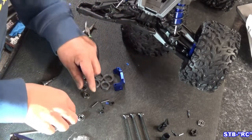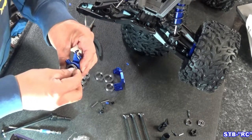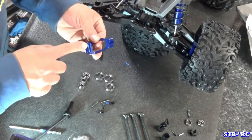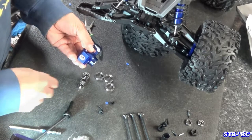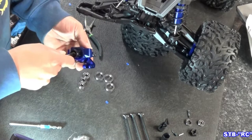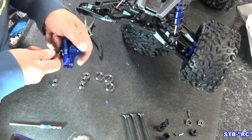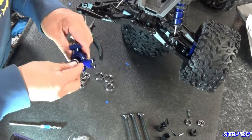We've got all our new bearings laid out — four large and four small. The back bearing will go on the outermost race, only place it can go. Now we've got our new bearings in to accept the new axles. Let's go ahead and put the assembly back together — hold it with the wide mount at the bottom — and it goes right back in. Drop in your pins, retainers, upper retainer, tighten them up. Let's put the axle in. It likes to push the front bearing out, so it takes a little persuasion, but it'll pop in there.